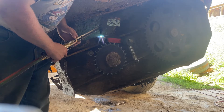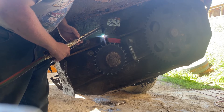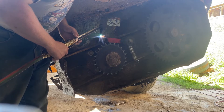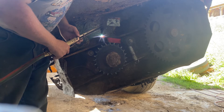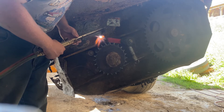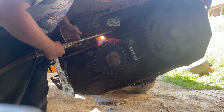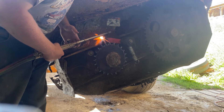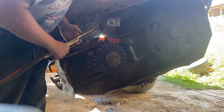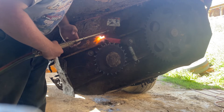I probably put a little bit too heavy of steel for this tab, but sometimes these things bend and then the tensioner comes off and creates a whole mess. I figured this time — this is probably the third time I've put a new tab on it — I'll make it a little heavier so it can't bend so easily under its own pressure. But in turn, that means I've got to heat it up to send it back to its original place.